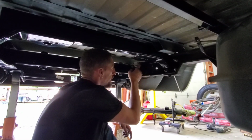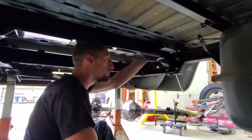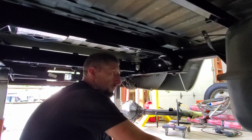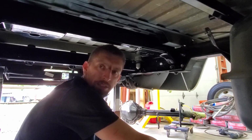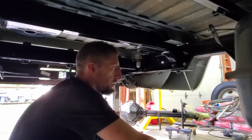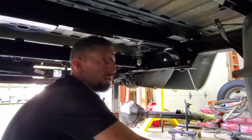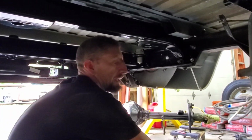All it needs. And then from here up to the top of the frame rail, through the grommet hole, air fittings. And then I still gotta pressure test the air tank. I gotta put all the fittings in the air tank that I need, and then pressure test it before it goes in. And then that can go in tomorrow along with the rear end. Actually might look like a truck again tomorrow.